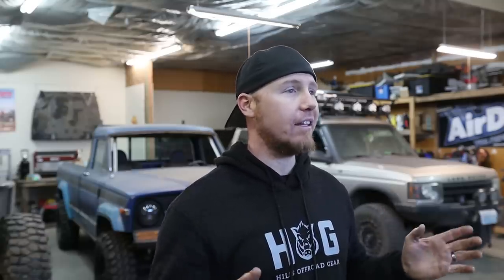The next selectable locker is an electric locker. I really like the concept and the simplicity — it works with just the same switch on the dash. You turn it on, it sends an electric current to an electromagnet, and it locks the locker together. You're not worried about running out of air or a busted air line — only the electrical portion. I'm really attracted to that idea. I'm not so attracted to the concern that if you have really dirty fluid with a lot of metal shavings — which happens in all differentials — all that could stick to the electromagnet. I'm not sure if that's a common problem, but it's something I've always thought about when researching what lockers to use. I'm definitely going to use an electric locker in the future and I've always wanted to see what the reliability is like, so you'll more than likely see me use these on this channel.